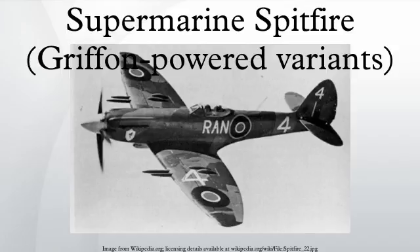Although initially based on the Mk-8 airframe, common improvements made in aircraft produced later included the cutback fuselage and teardrop canopies, and the E-type wing with improved armament. The Mk-14 differed from the Mk-12 in that the longer, two-stage supercharged Griffon 65, producing 2,050 horsepower, was mounted 10 inches further forward, the top section of the engine bulkhead was angled forward, creating a distinctive change of angle to the upper cowling's rear edge. A new five-bladed Rotol propeller of 10 feet 5 inches in diameter was used, although one prototype JF-321 was fitted with a six-bladed contra-rotating unit. The fishtail design of ejector exhaust stubs gave way to ones of circular section.